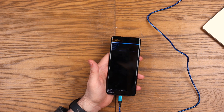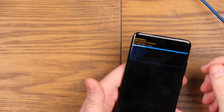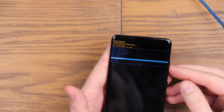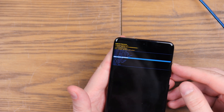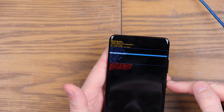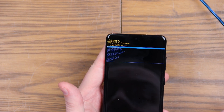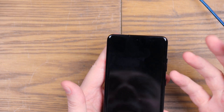There you go - I'll try to zoom in so you can see it. Standard recovery menu, and then in the usual way volume keys to navigate - volume down to go down the list. We're going to navigate until we get to 'wipe data factory reset', which is about halfway down. I can't actually see it because I've got glare on the screen. Then use the power button to select, press down again to confirm, and that's just going to wipe the device. Then press the power button once and that will reboot it - super quick like that.